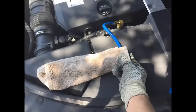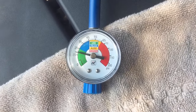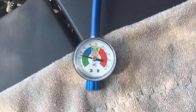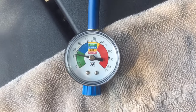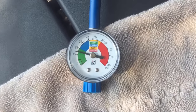So I let some more pressure out, a few seconds at a time, until the pressure stabilized again at the full blast of air conditioning. Now it's stable — as you can see, the pressure has stabilized at about 20 psi, which is even lower than before. According to the gauge that's way too low, but if you add just a little bit more it goes overboard. I'm not sure if this is a bad pressure sensor or something else going on, but it works for now and I'm happy.